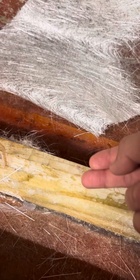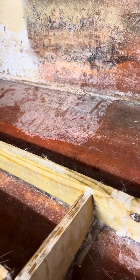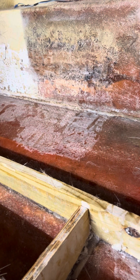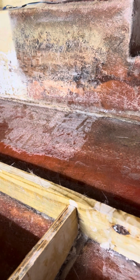Today's goal is to get the second layer wrapped around the top of the stringers. All the stringers have fiberglass that come up to about midsection. The next thing is to wrap it, and once I get it wrapped with the chop strand, the next step would be to put a 1708 biax on it. And once the biax is on it, I'm going to call it done. I use some pretty thick, heavy resin-absorbing CSM, and the biax should pretty much be the end of it — shouldn't be any more needed. But you can see where I've come down here — it's all completely done at this point on the initial stringers.